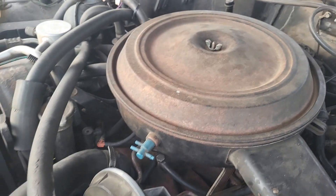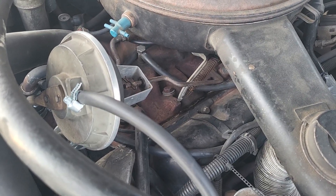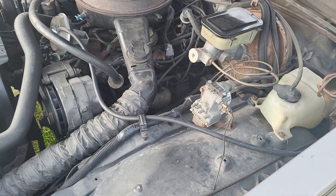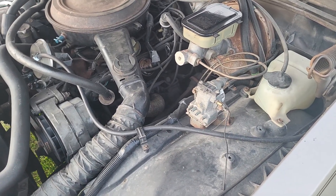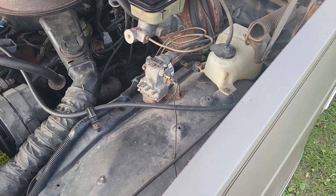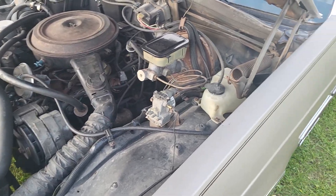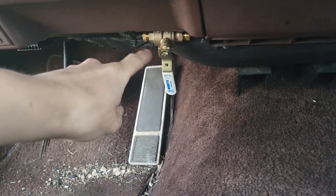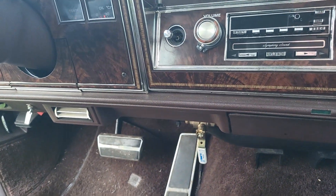If you're able to tap into your firewall in an easy spot, it shouldn't take long and it won't cost you much — you can do this for under a hundred dollars versus aftermarket cruise control kits that go for around $300. Those come with a big rat's nest of wiring you have to stuff under a seat or behind the glove box, with unlabeled wires you have to figure out how to connect. Often they have tacky plastic switches that stick onto the bottom of the column and make it look like some kind of import. This is entirely analog. If I really took the time and effort to hide it a little more, it wouldn't look like anything aftermarket was done to this car.